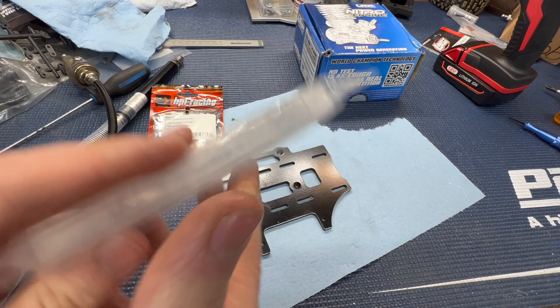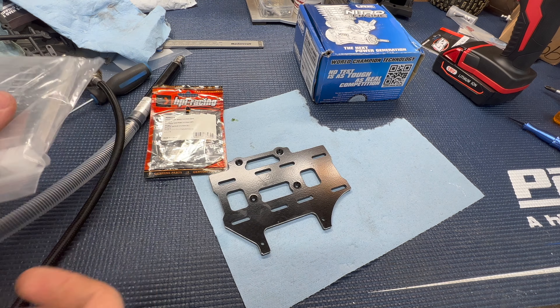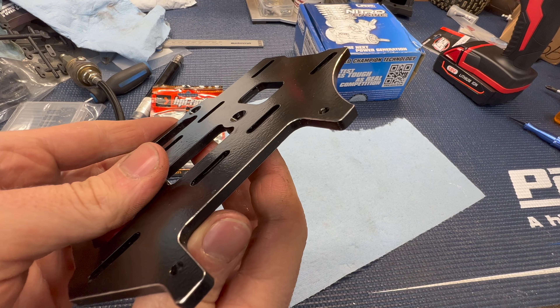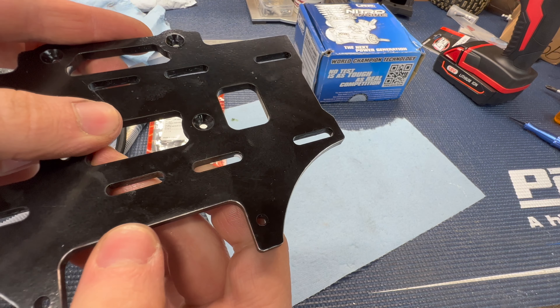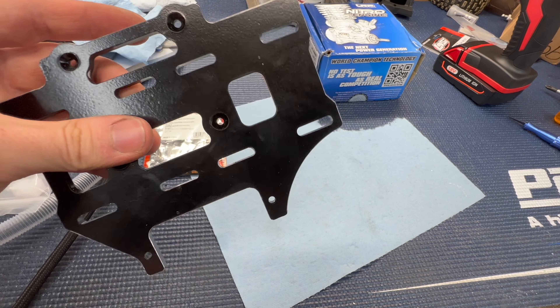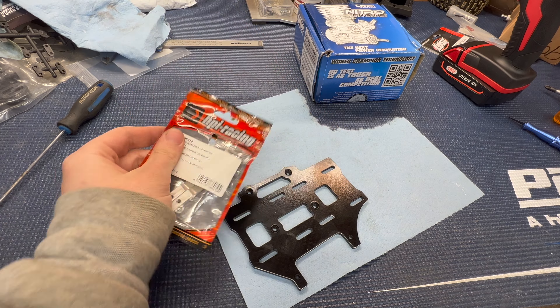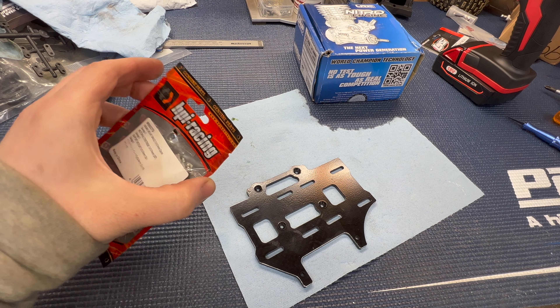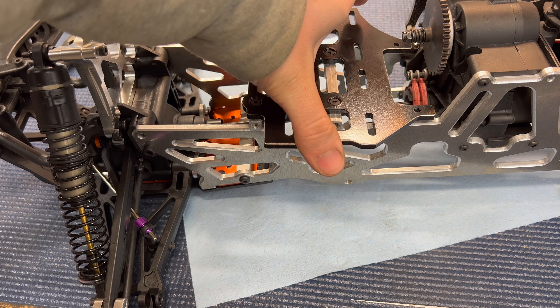Here she is all disassembled. I'll show you guys real quick — here's the crank, he signed it, made some cuts, drilled and filled the crank. The piston should be bone stock. Just run by the sleeve real quick, you can see some of the cuts he made right there to the exhaust as well.